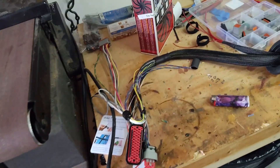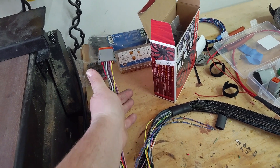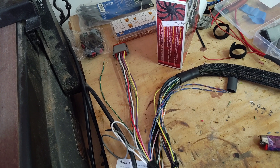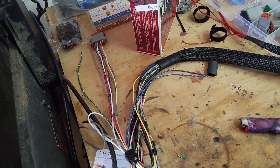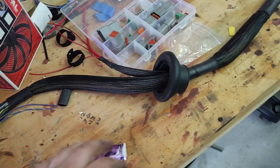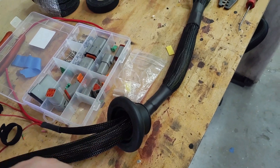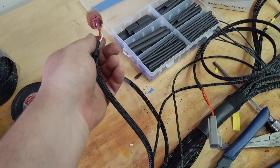Here's the harness so far. I put a 12-pin Deutsch connector on for everything that goes in the chassis — everything from 12-volt switch to my boost control switch to the map switching, fuel pump — all that's going through there. And then everything's nice and neatly loomed. I got a new grommet for my firewall and then I started putting my new connectors on.